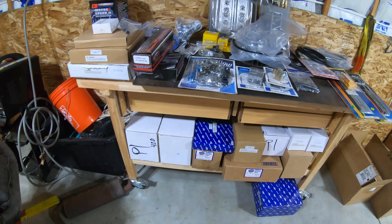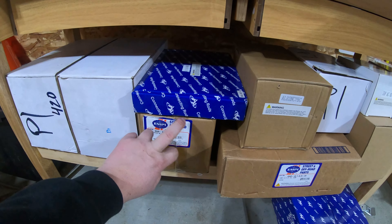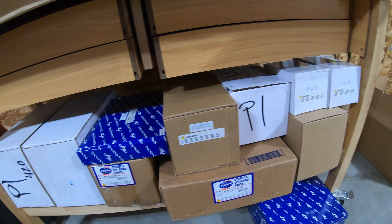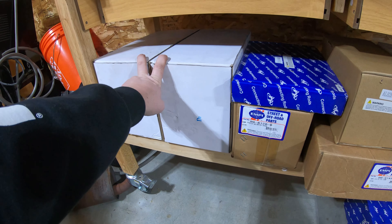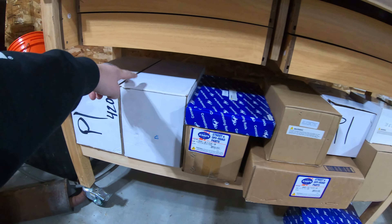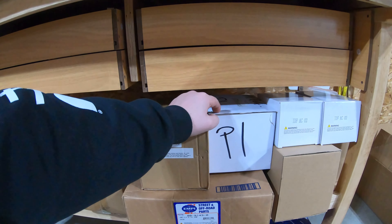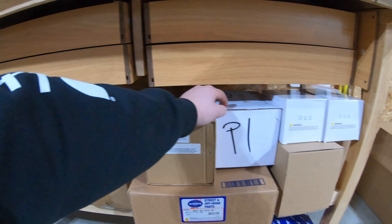Here's the stock engine. For parts: we're doing a stock 69mm counterweighted crank — I didn't want to have the block machined or anything, just wanted to keep it at 1600. So stock counterweighted crank, stock rods, stock size pistons — rotating assembly wise it'll be a stock size engine. From AA Performance, these are their ported heads with bigger valves, ported intake and exhaust, valves all installed and ready to go. And this is the chrome alternator for the dress-up kit, and an MP three-and-a-half quart oil sump.